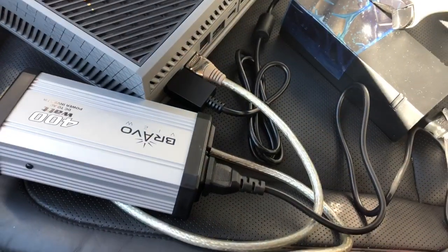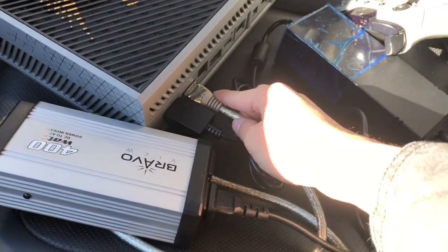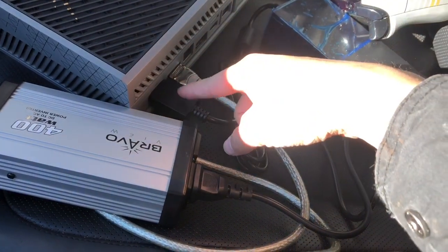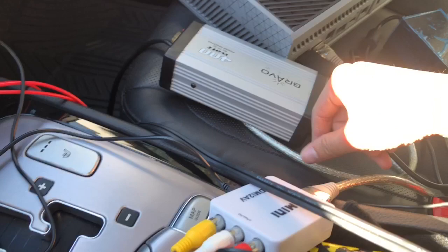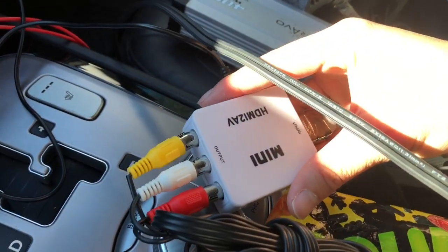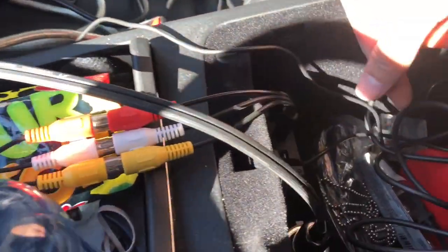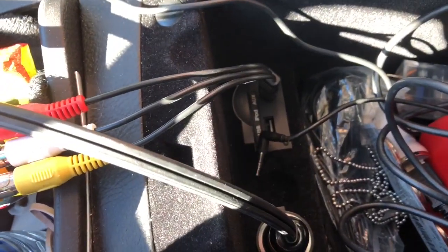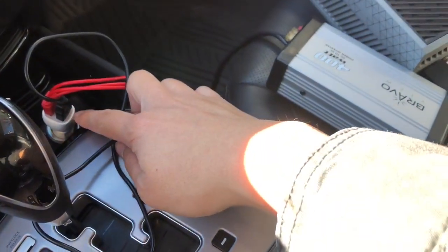Now we plug in all the cables, and this is how it goes down. You got the power brick going in here, HDMI cable here. On the other side, the power brick goes into this power inverter. The HDMI cable goes into this HDMI 2AV adapter. Then we have the output of the RCA going in here, and into the car's aux input right there. The other side of this is USB, so I just plug it into a standard charger like this.